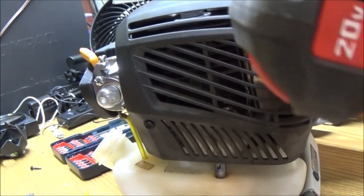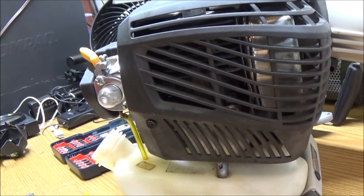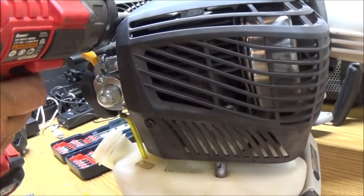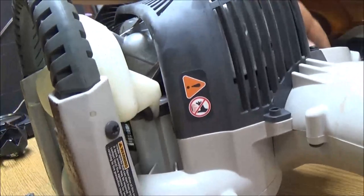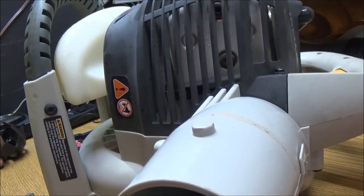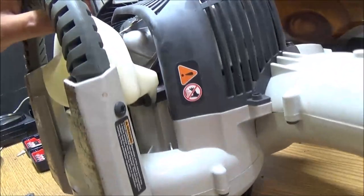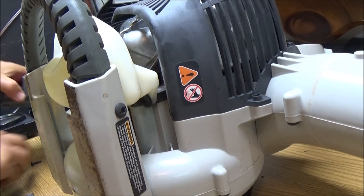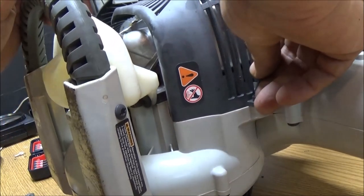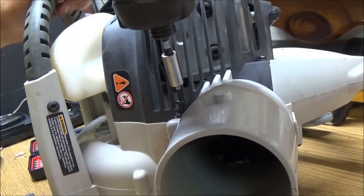Watch, it was probably just a bad spark plug or something. I had a guy bring me a lawnmower one time. He says, I don't know what's going on. He's one of them guys, oh, I've been working on things since I was a kid, I know everything. But this one's got me stumped. Okay, alright, no problem. What you got going on? Well, it won't run. It wasn't getting any fuel, so I'm missing a screw. It wasn't getting any fuel, so I put a new carburetor on it, still won't run.